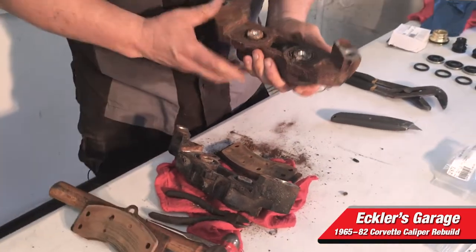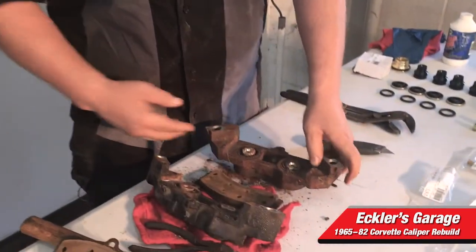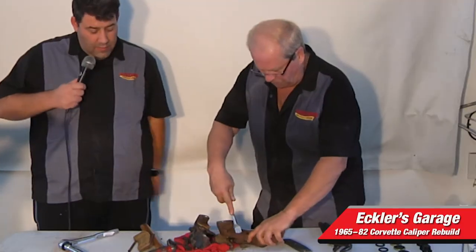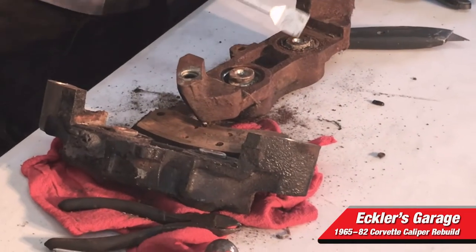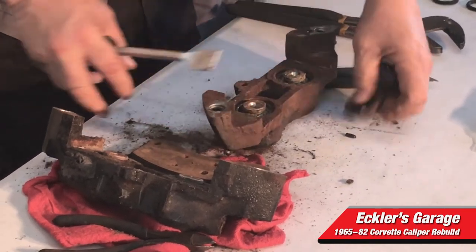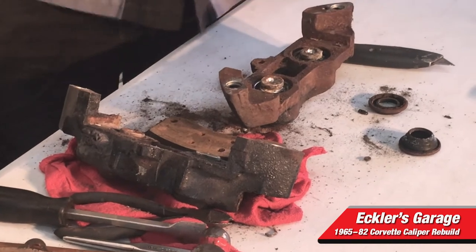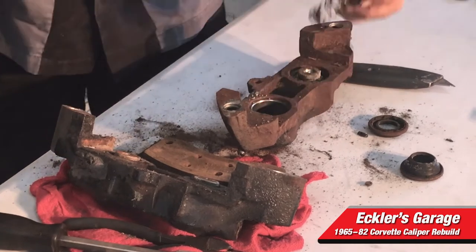I have the caliper apart now and you can see how corroded it is on the inside — this looks really horrible. The thing we did find when we took the other caliper apart is that these are stainless steel lines, so we'll be able to reuse them. If these were steel calipers, we would have to throw these away or get one of our stainless steel lined caliper products, or we have a rebuild service where you can send yours in and get them lined. That part number will be in the description. If you take this apart and they are not stainless steel lined, we'll give you the correct part number for what you need.